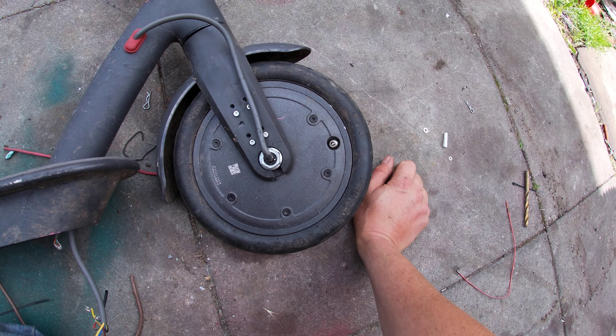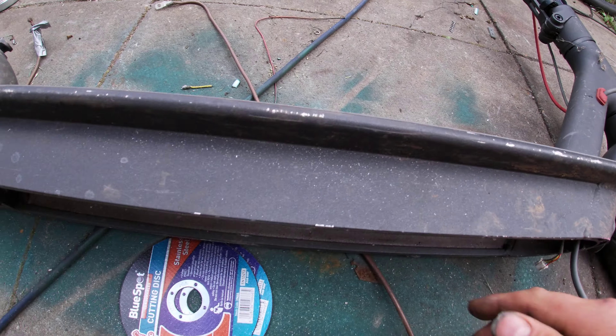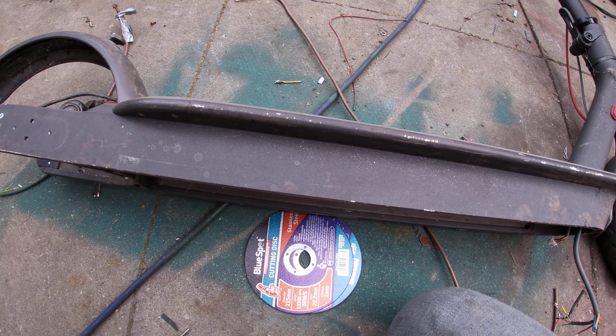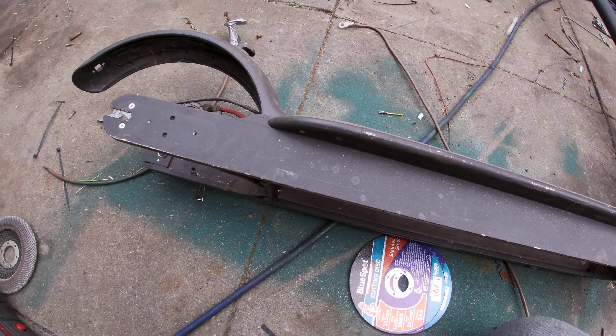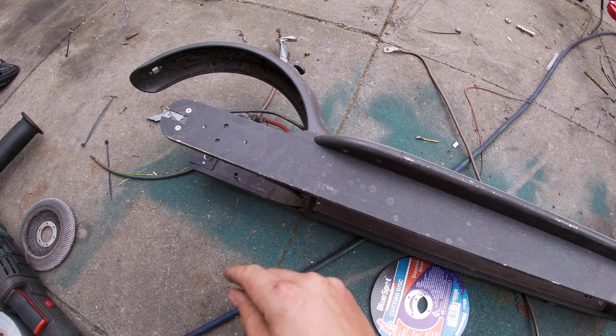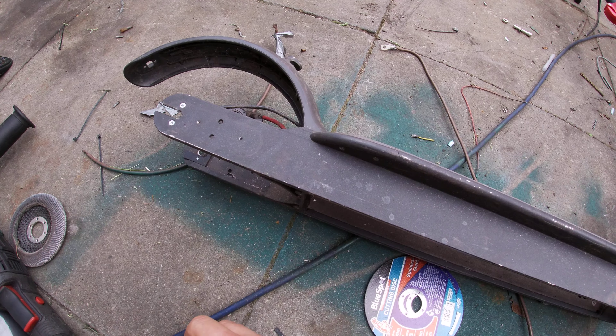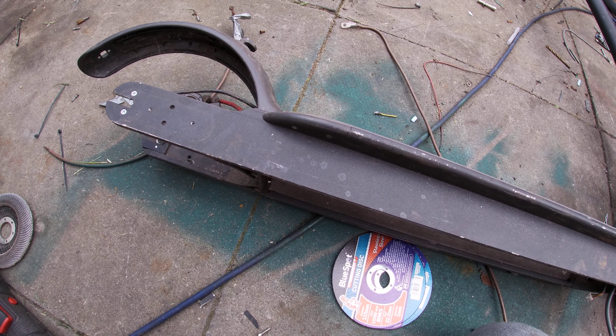The pro motor wheel spins like mad on the front at 72 volts or even 22s, which is obviously higher - 72 volts being 20s, 22s is as high as we can go on a 72 volt controller. I might try 96 volts if this video gets enough views, and put two 96 volt controllers in here. The battery's going to be in a bag up there somewhere, and yeah it's going to be pretty gnarly.